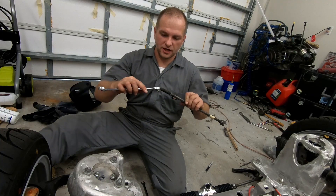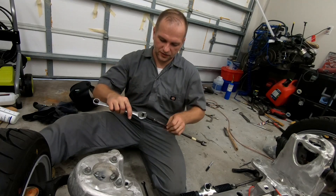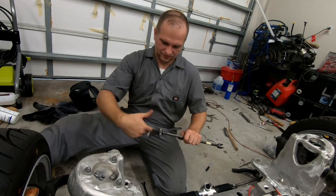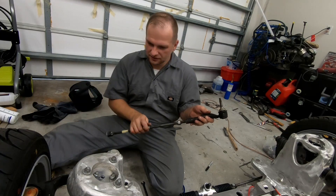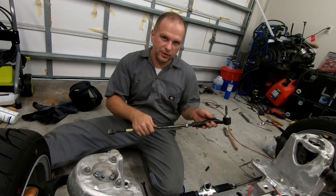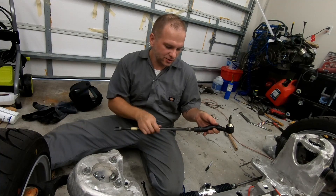So now we're going to put our lock nut back on here, bring it all the way down, put our tie rod end on, and then we'll give it a test fit. Right now we got it toed in on both sides, so that way we can make the adjustment outwards, since I'm going to bring it in as much as possible.